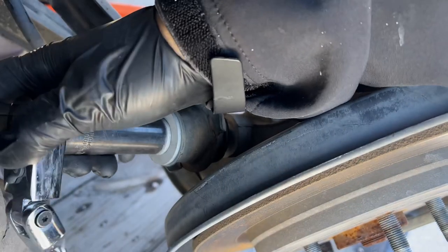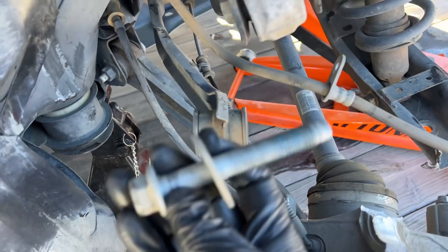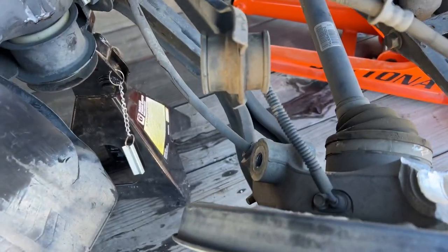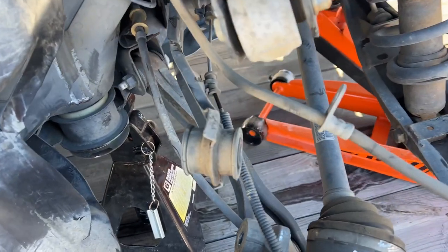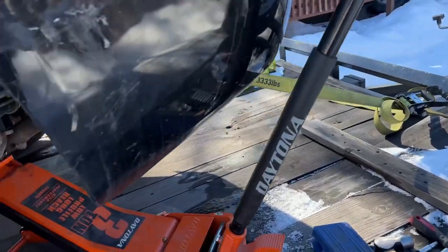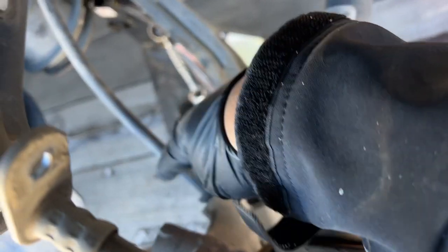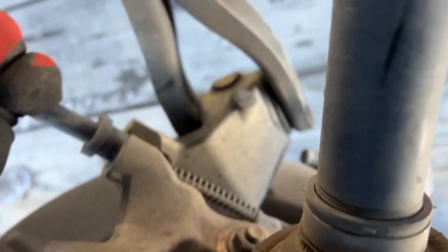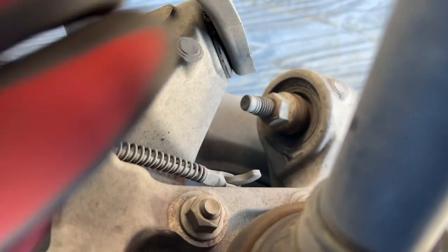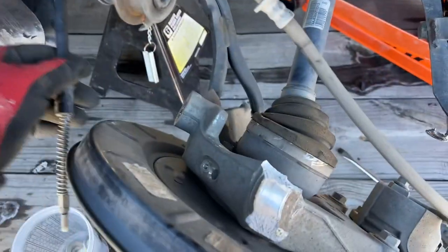I'm trying to take off this upper link — this upper link here actually has a pretty long bolt, it's a 3/4. Now I'm gonna take off this ABS sensor and probably move on to this trailing arm, and add another strap because I'm gonna go ahead and take out this emergency brake. It looks like it's just gonna slide out through here, and then I'll hook it from right there. I got the emergency brake out.